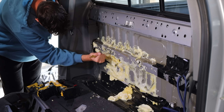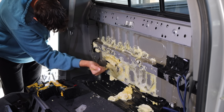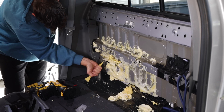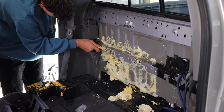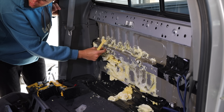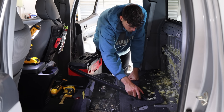This back wall of the truck probably gave me the most problems. First it was layered in that sound deadening, a bunch of black duct tape, and once I finally got that all off, there was a bunch of spray foam underneath. This stuff had been sitting there so long it felt almost like concrete when I was chipping away at it — very difficult to get out, in all these little nooks and crannies.